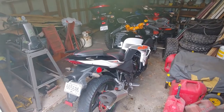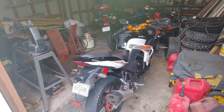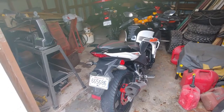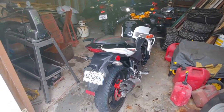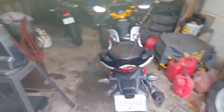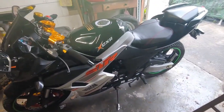JerryHawk250 here, getting ready to do a bunch of mods on my bike — the X22R 250 from Venom Motorsports USA. I got a whole list of mods to do today: first, pull the exhaust off, locate the catalytic converter and remove it, put the header wrap on, rejet the carburetor, and put an oil cooler on it. I also got a sprocket to put on.